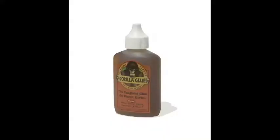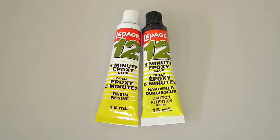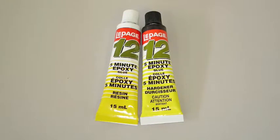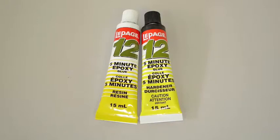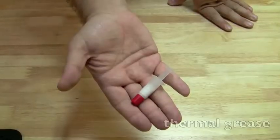The next thing is glue. I use Elmer's carpenter's glue very sparingly. The main glues I actually use are a little bit of gorilla glue, but mainly crazy glue. Crazy glue is great for attaching plastic to plastic, and a lot of laptop repairs are just dealing with plastic, so I definitely recommend crazy glue — it's cheap and you can get it pretty much anywhere. When you need a stronger bond, try epoxy. They make a five-minute epoxy which dries in five minutes — I recommend letting it sit overnight. You have to mix two tubes of material; it smells strong, so be in a ventilated area, but it does provide a strong bond.